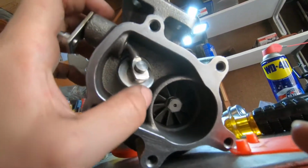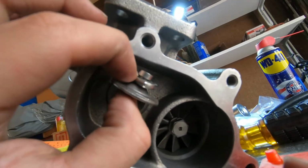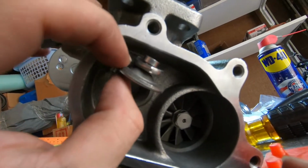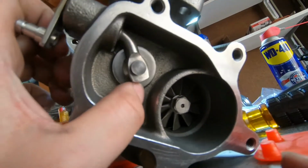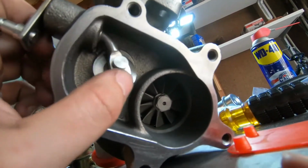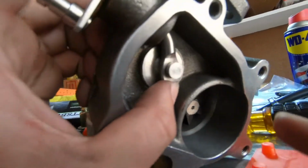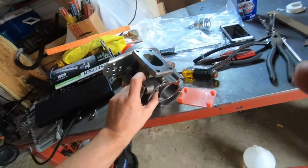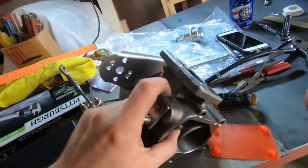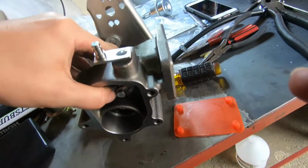So we're gonna have to adjust this flap, probably weld it tight like right there, so it doesn't have this play in it, and then it'll work no problem, because you see it does close. It just has to be adjusted properly. So we'll probably have to close it like this, tack it up a few places here. I just gotta get a hold of a TIG welder, because at this point I don't have a TIG welder. We still gotta get that going, and then we should be good with that.